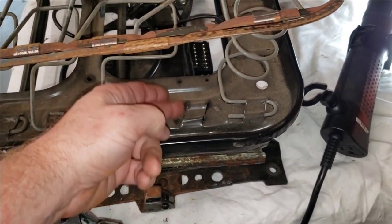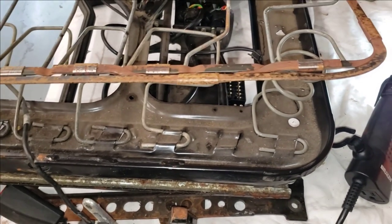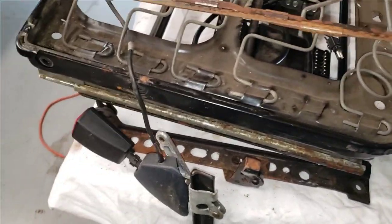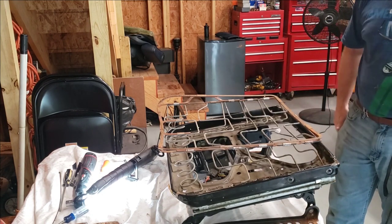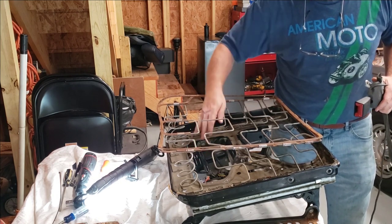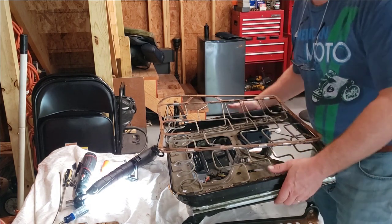And of course there's our missing one — it's not missing, it just wasn't there from the factory. They chose not to put it there from the factory, which is not a good idea. The seat belt wiring harness — that's the small one we disconnected earlier — I'm going to pull that out of there. This driver's seat is a little more complicated than the other one because it has this extra box here — this must be the memory module for the seats. Let's get these springs off of the frame.